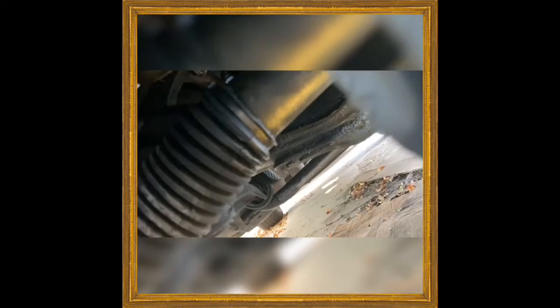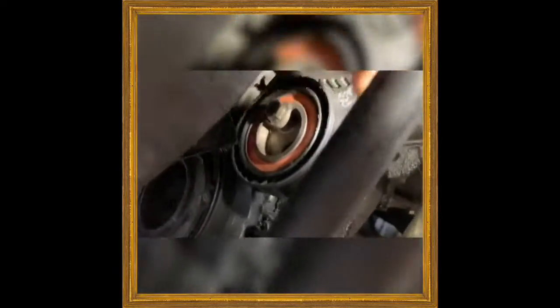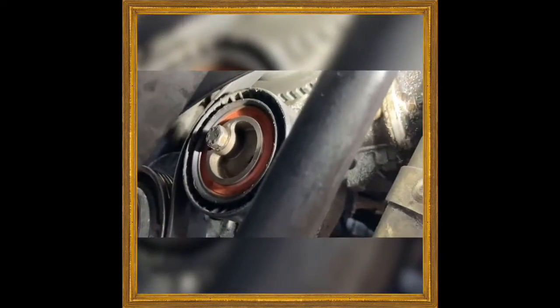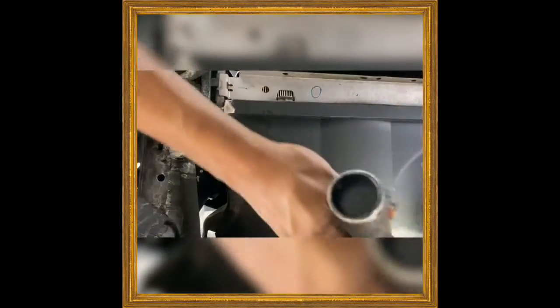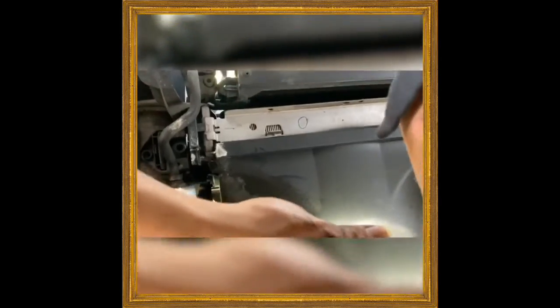Now you don't have to take the bolt all the way off. Once the tensioner drops down, which you will after the first quarter revolution, like 30 degrees, and then it went down. So now next, all you do is take the belt off from the tensioner, from the front of the harmonic balancer, and then from the AC compressor, and once you get it over the pulley and away from the fan shroud, you'll be able to get it off.